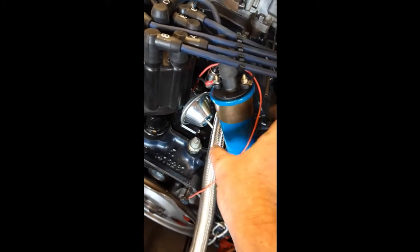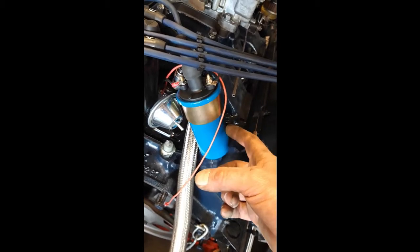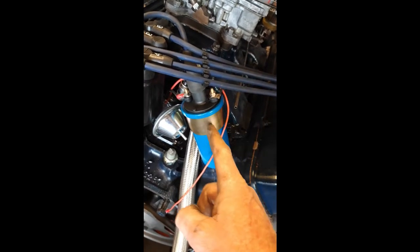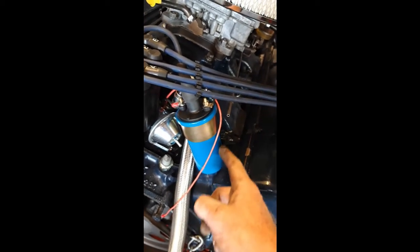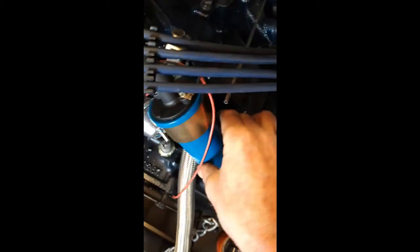Now then, Sunday again. All these Sundays fly by. Been doing bits and bobs today on the caddy, obviously. Coil done. That was mounted on the top here, flat. Needed to be more vertical because it's oil filled, so the coil gets hot. So if you have it horizontal, the oil sits level and doesn't cool the rest of the coil. So I've made a new bracket, fabricated one of them, and that's on nice and tidy. So that's a good job done.